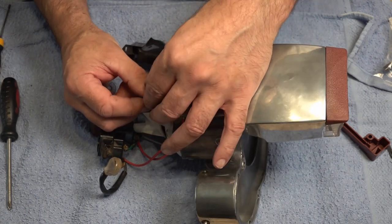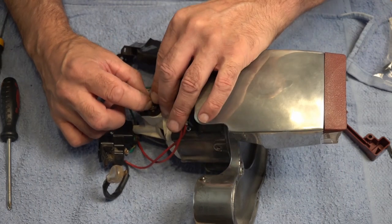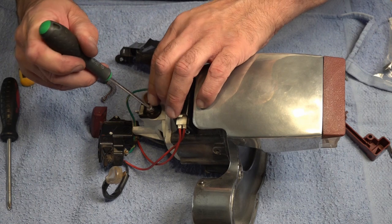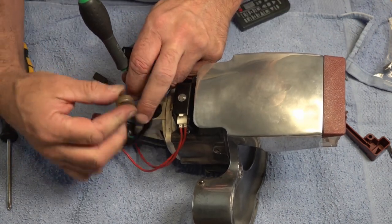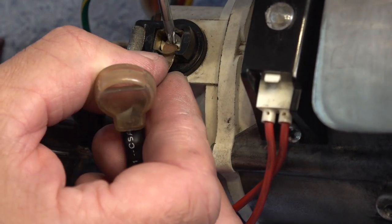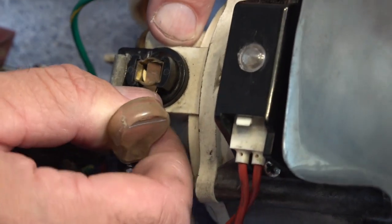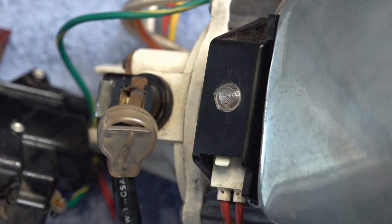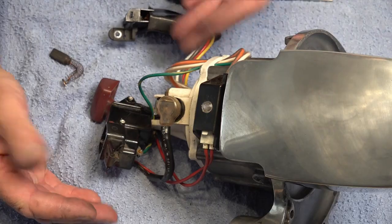So what you're going to do is push that down, press it down with the screwdriver in the middle, just to hold it down. Don't put your eyes over it, because you don't want it shooting up and blinding you. So push it down with the screwdriver, slot your little brass fitting in, just so it touches the screwdriver, lift that out gently and slide that in, and then push that in, and it should clip in place, like so. Put your cover cap on, and just repeat that on the underneath.